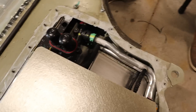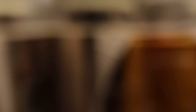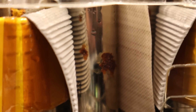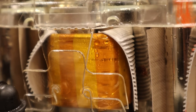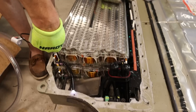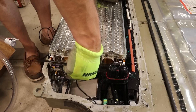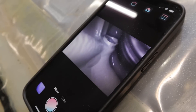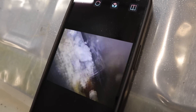With the cover off, we can see this mica sheet here, which we'll take off in a second. On the far right side are the coolant pipes, coolant quick disconnects, and some corrosion. We certainly saw some water inside here on the batteries — definitely some droplets and some surface rust, just kind of on the outside of a few cells, but there was definitely some water in here. There was also some water on the case itself. Rob used the endoscope to look around in here and get a view of some places we otherwise wouldn't be able to see — a handy tool to have around.